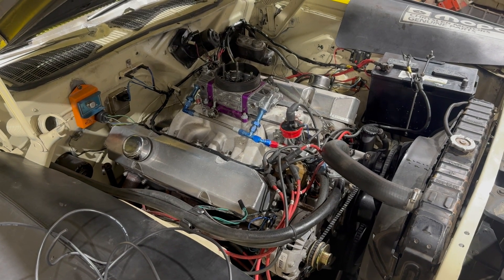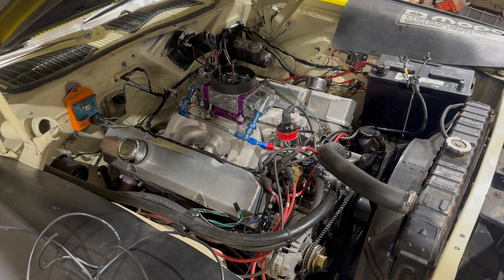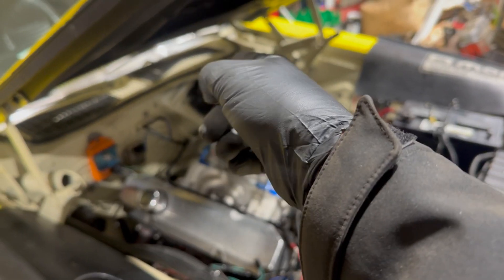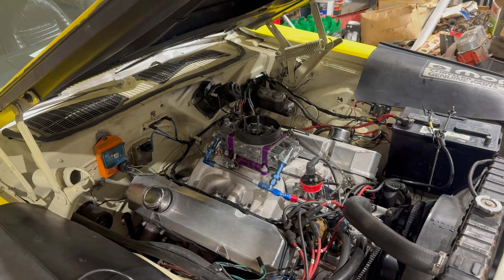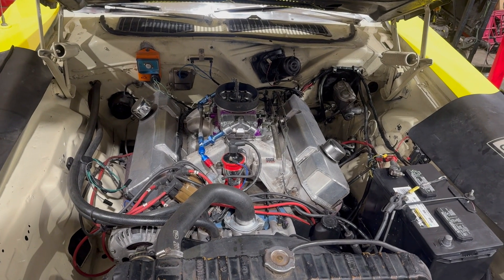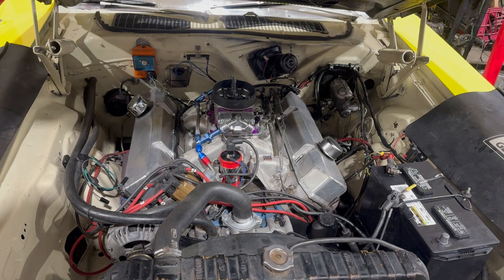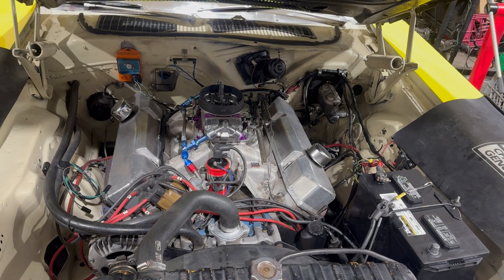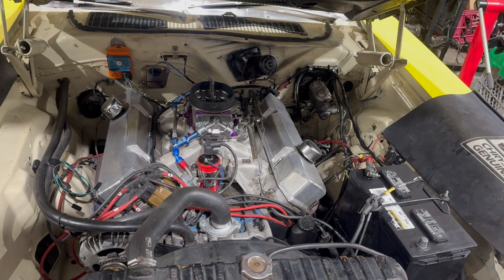When it was engineered, that firewall connection was just barely adequate to handle any load coming out of a 35-amp alternator. And as the components age, their ability to carry that power is further reduced. So you end up with situations like we saw in this car, where everything is melted and horrible and you end up replacing all of the wiring. Now that those connections are shiny and new, they should be good to go, right? Well, sure — for a while. But eventually, this replacement, engineered exactly like the factory components, will do exactly the same thing.